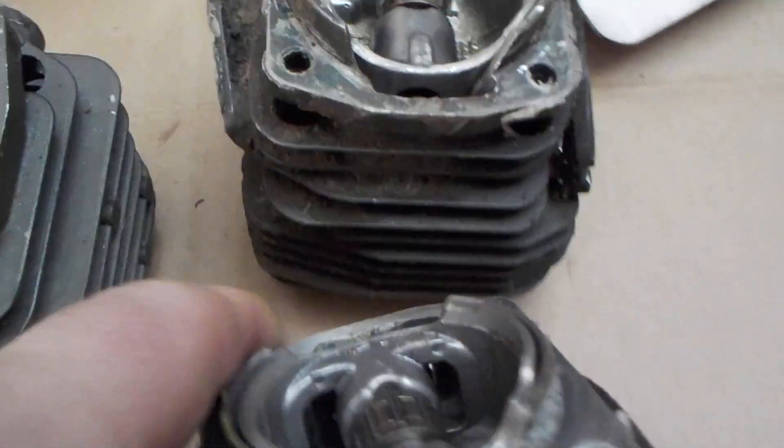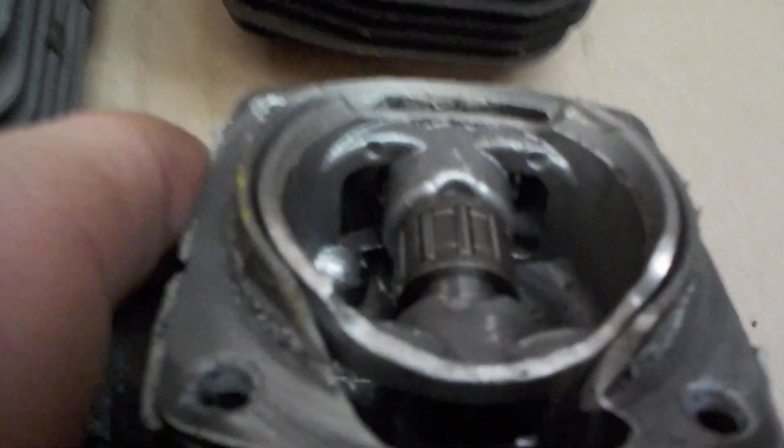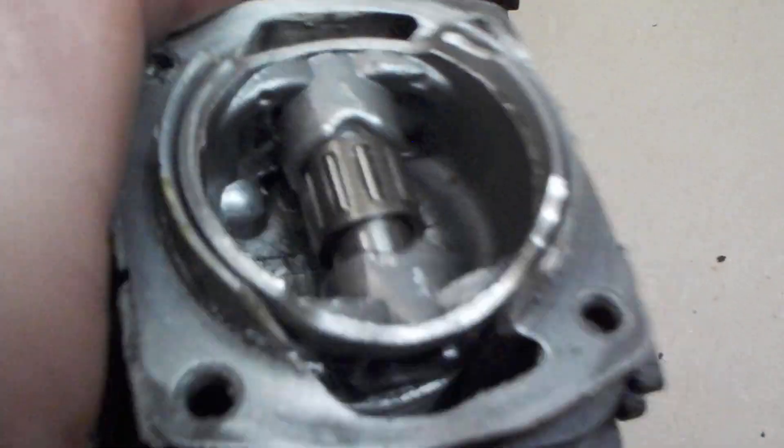This is the 54cc one. Again, with the dividers hogged out down the bottom. It's got a window piston and there's way more flow. I get more power out of the smaller cylinder than the big one.